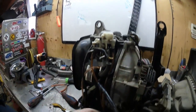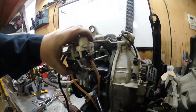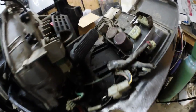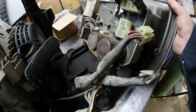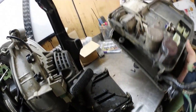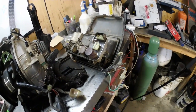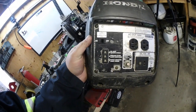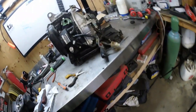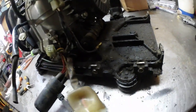I've got the fuel tank removed. The electronic throttle for the carburetor has been removed so the carburetor will just slide completely off. This is all cleared away from the electronics. All the wiring is disconnected so this should just pull out — and it does. We're going to have to clean that up because it is filthy. The four screws on the cover that hold this face plate on — you don't have to remove them, but now I've got to clean it all up.